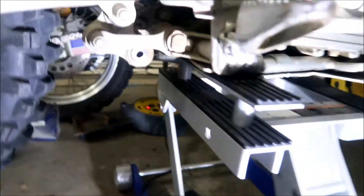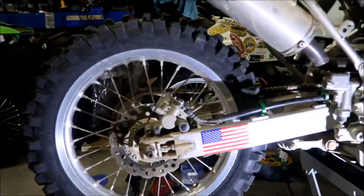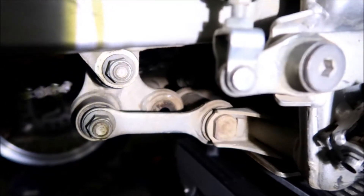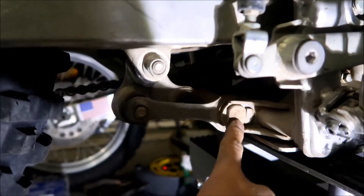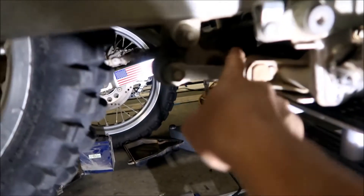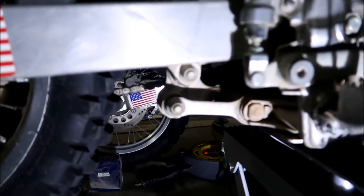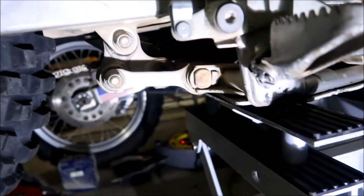Let me move the swing arm up — see, there's plenty of clearance. I can go up quite a bit. See that? See how close that comes to this part of the linkage — the part that holds the dog bones. It's almost touching, like it's got a millimeter of clearance. I believe if you flip this, it's gonna hit. That's why we have to grind it. We're gonna grind it a millimeter or two and then check for clearance. Right now there is clearance, but it's very close.